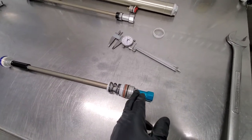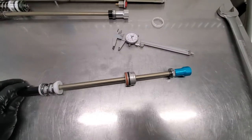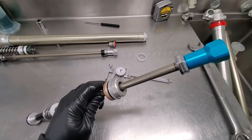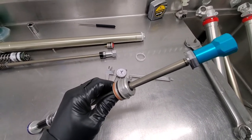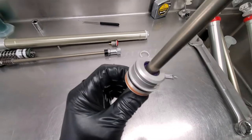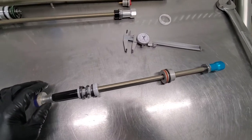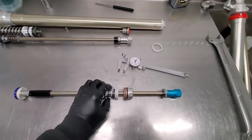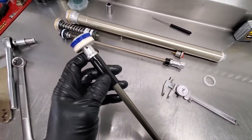A couple other changes on the air side: there's a different diameter seal housing at the end here — I'll separate these pieces so you can see. I hadn't measured back to back with the other one, but we're talking about a 24 to 32 millimeter wrench to get this seal housing off. It literally just has a couple seals and a bushing in there. There's also a different machine nut on there. The top out spring remains the same, may have made a small insignificant change.